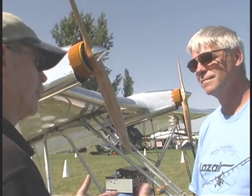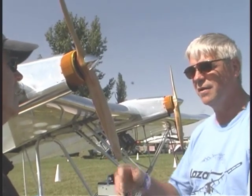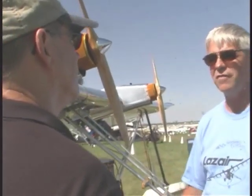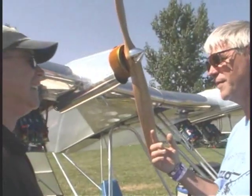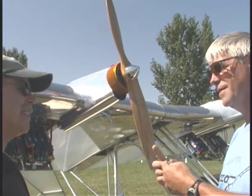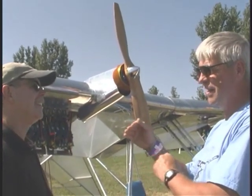What do they make the motors for? The motors are a bit of an offshoot of some wind generation technology they're developing — power generation from wind at high altitude down tethers. They also have an intention of making a vertical takeoff manned aircraft with eight of these engines. Actually, one of my goals is when I'm going up in a thermal, I'll put the controller in regeneration mode and just extract some energy out of the thermal as I'm climbing — maybe climb at 500 feet per minute and put that energy back into the batteries.